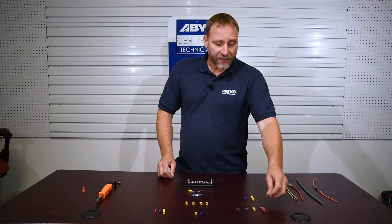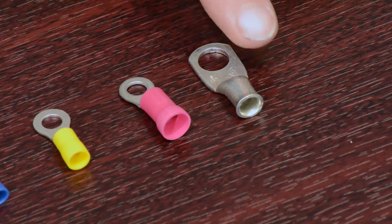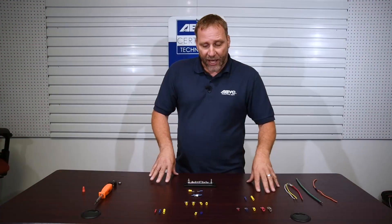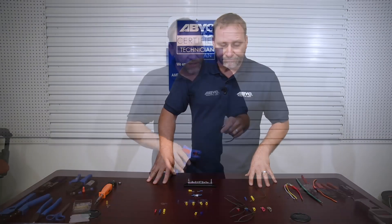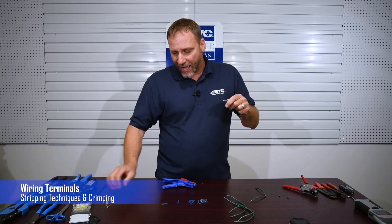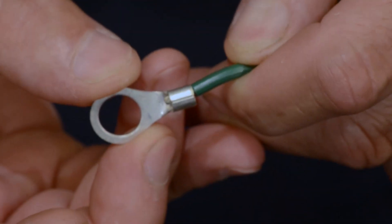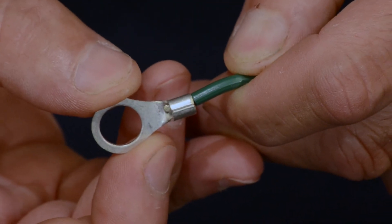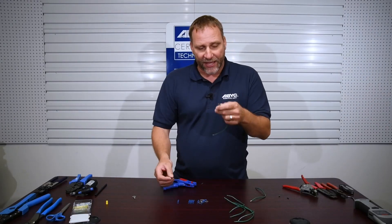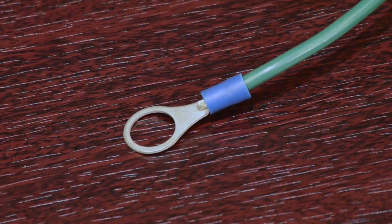Moving to the next step, we can see a battery lug, which we'd use when we get below maybe 6 or 8 gauge wire — we're going to go to lugs. So when picking things out, we have different size wire requirements and different ring requirements for ring terminals. How much wire do we strip? About three-sixteenths to a quarter of an inch. We want the insulation to just meet that barrel with a little bit protruding on the outside. That's exactly what we want. Now I'm ready to put this wire into one of these ring terminals, making sure it fits in there nice and neat.